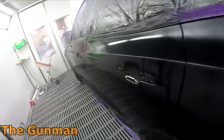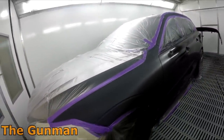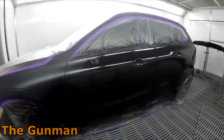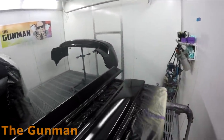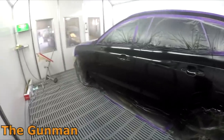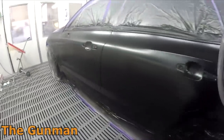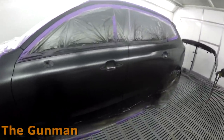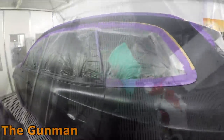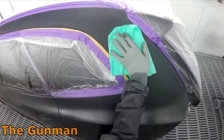I found it works totally fine — I never used to use blender on most dark colors with solvent-based paint either. The only reason I would sometimes use it is to stop the base coat going a little dry and dusty on the blend panel. So if you do spray darker colors with this system without blender, make sure you give those blend areas a good tack rag down, because your own overspray can dry and land on the blend — I call it a sand pit — and when you clear over it you can end up with tiny little bits of dust in the finish.